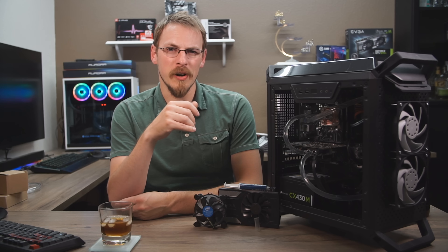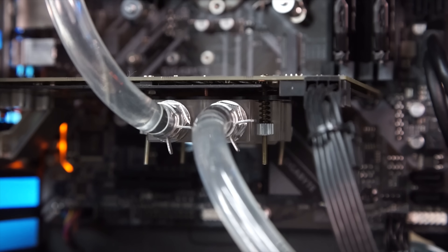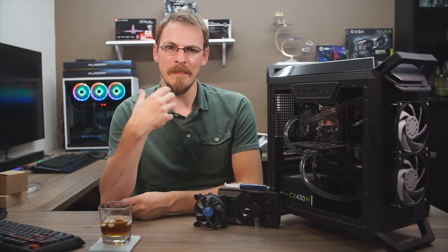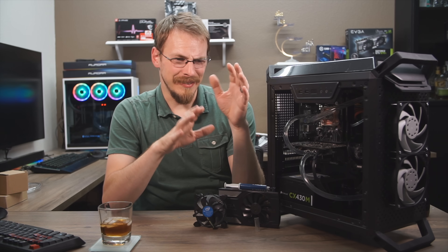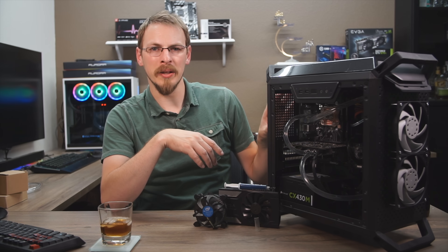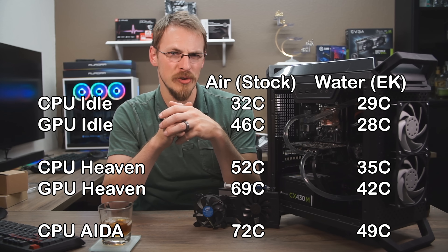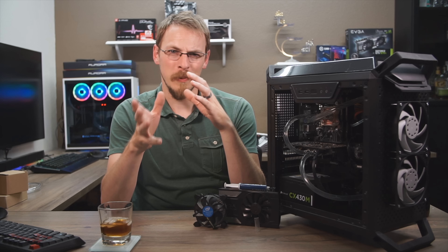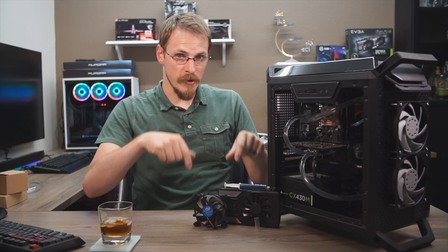The GPU block is actually not a terrible cooler as far as the GPU die goes, but the problem is it doesn't cool the VRMs or the memory. I know from experience — because I burned up an R9 390X on my very first liquid cooled loop — that you need to actively cool the VRMs on a GPU or have a decent amount of air flowing over them. I will never use a universal block again on a GPU full time. Now the loop actually did perform decently: it did keep the GPU die and the CPU cool, but I wouldn't trust this long term because of the quality of the parts, the mixing of metals, and everything else. That being said, I got a 20 degree drop on the CPU in AIDA64 and a 35 degree drop on my GPU die in the Heaven benchmark. Did it perform better than the air coolers? Yes, as far as the die temperatures go. Would I trust this over the air coolers? Not a chance.